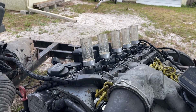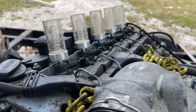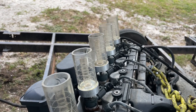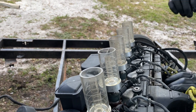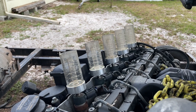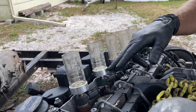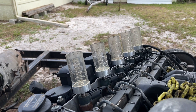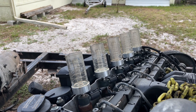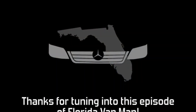That might not have been 10 seconds, but I can see right away what we're getting here — which is nothing. That's a whole lot of nothing. So we don't have a pressure loss at the fuel rail that we can measure, and we don't have any pressure loss on the injectors that we can measure. That tells me we're probably not getting pressure. We continue to look for why this engine won't start.